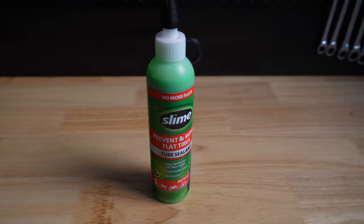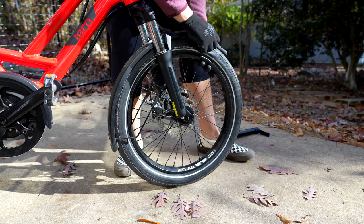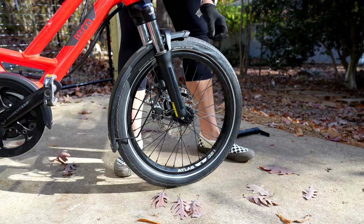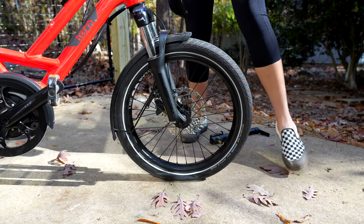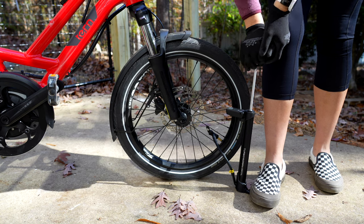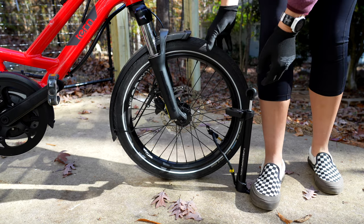The reason I carry only a pump — no tire levers, no replacement tube — is because I run Slime in all of my city bike tubes. This is a sealant that runs inside the tube. When I get a puncture, it can help seal it. Using my gloves, I pull whatever's in my tire out, move that hole to the bottom so the sealant can run on top of it, add air, and as long as it's not a big hole, it will clog. This can allow me to get home. I've had tubes with so many holes that the sealant clogged that I just didn't even know about — I just pumped up my tires and kept rolling. The pump also comes in handy if I forgot to pump up my tires before I left and I'm now far from home.